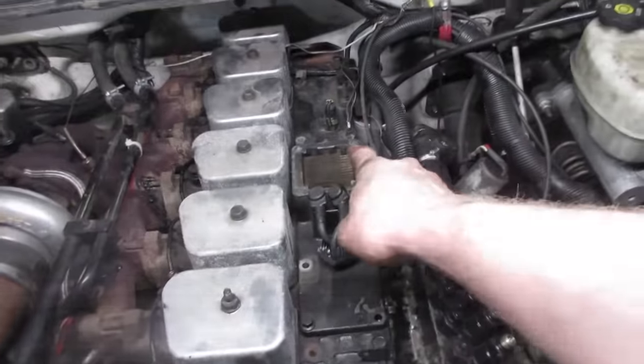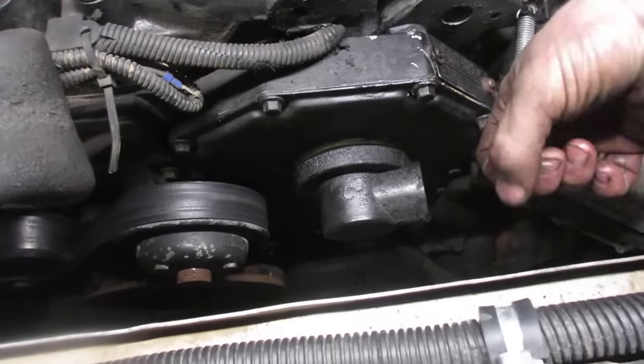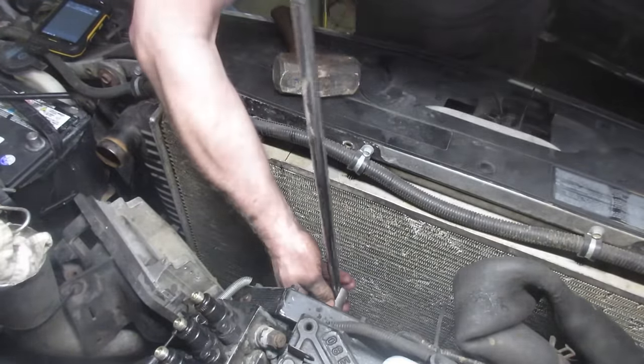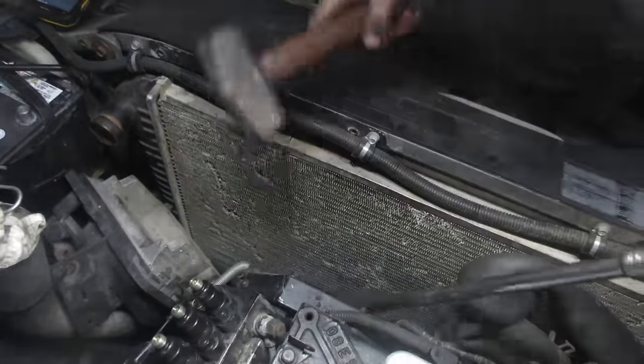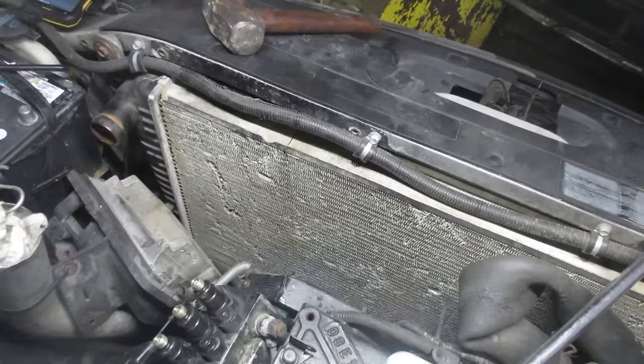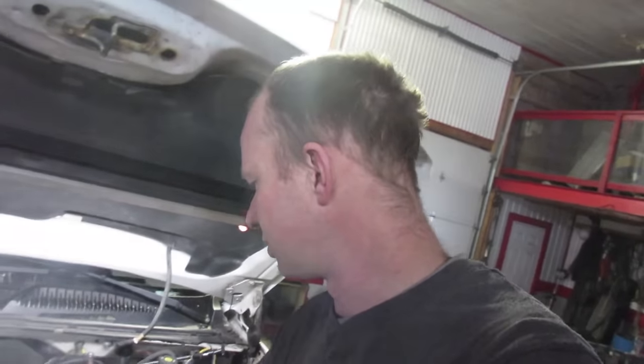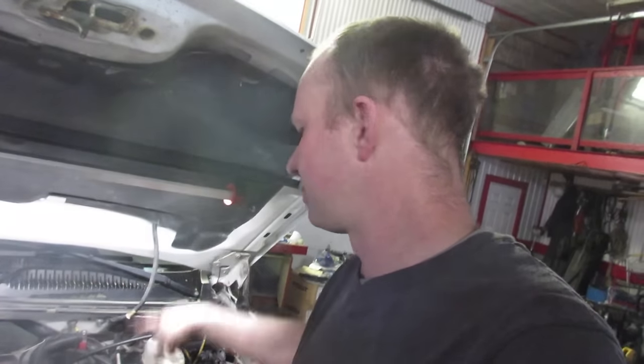Start by pulling your air cleaner off and your injection lines. We're gonna pull off our front oil fill - this part just unscrews that way and then this way. You'll see a big nut there - that's inch and a quarter - so we're gonna crack that nut loose. Then spin it over and find top dead center on a little flag on the side of the injection pump. You can stick it in gear - that works too.